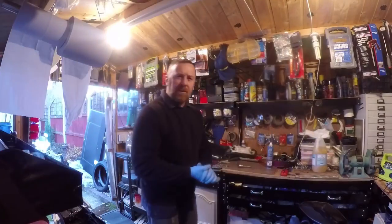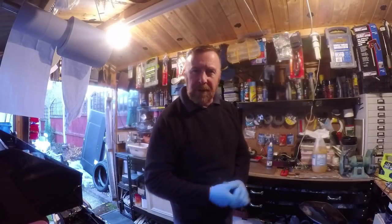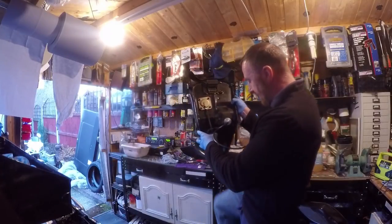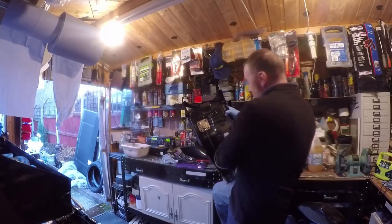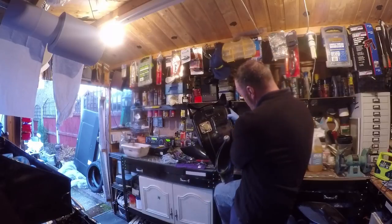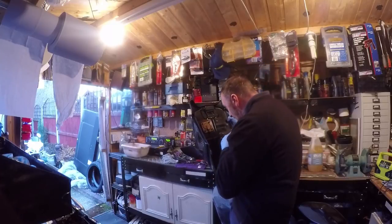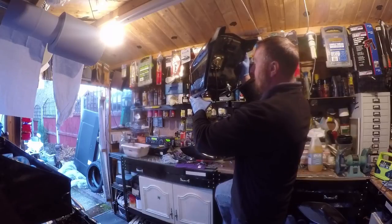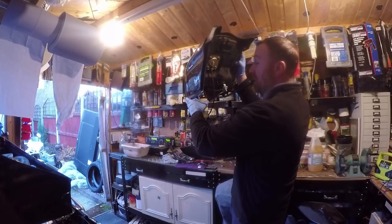Carburetor's all clean now. Battery - I always tell you to put it on charge. Petrol - here's what I made earlier. Okay, still the vacuum system. Get yourself a little pot, put your petrol in there. The bottom of the vacuum is the air, the other one's the fuel. So just for you looking - a bit awkward I know - but put that there and suck, and fuel will come out. Nicely filling up.